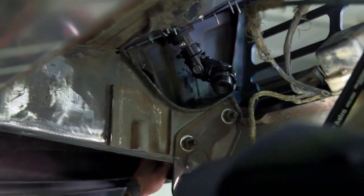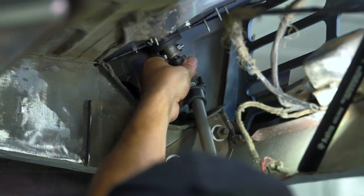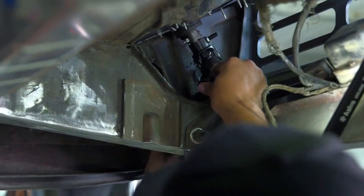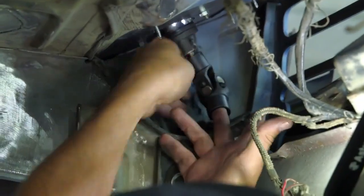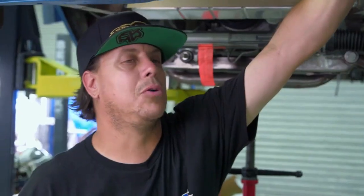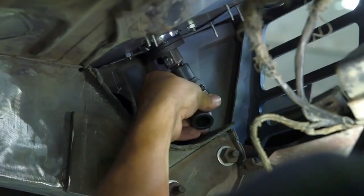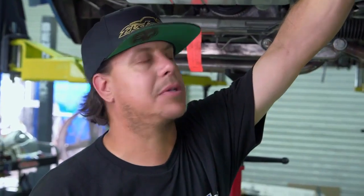I haven't either. The main thing you look for when you're figuring out a steering shaft is make sure all the U-joints aren't in a bind. You want it to be smooth, free, and clear. And double knuckle is too many moving parts all at once. There's no stabilization in something like that, so it's just going to flop all around. So it's one frustration after another, right? Yeah, man, you said it.